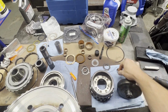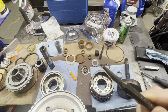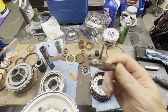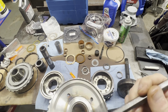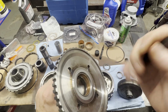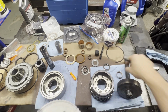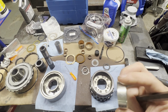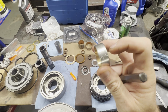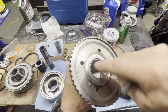So I'm going to take this over to the vise, and basically I've got a chisel or a punch, and I've ground the end down to a smaller surface. But basically you'll drive this down, you'll see it in the time lapse. You'll drive this down, and when it rolls inside of this cavity, sometimes they have a little puzzle piece that puzzles them together, and it will actually push it apart, and that way when this bushing rolls, you can just pull it out.